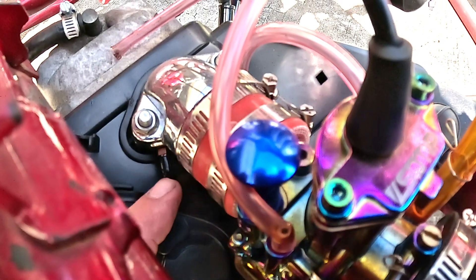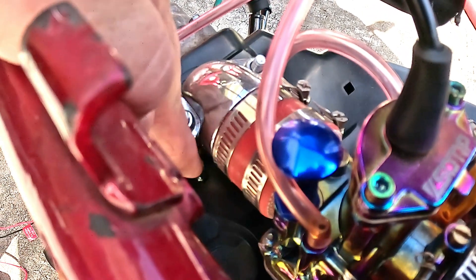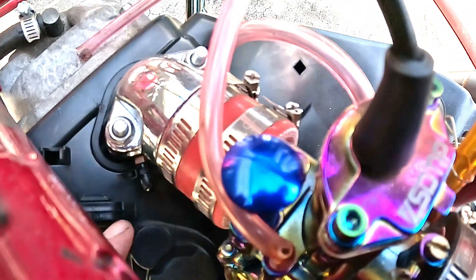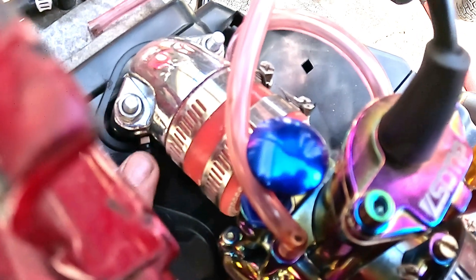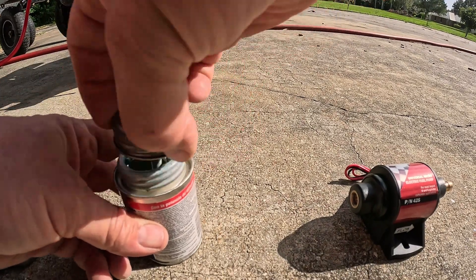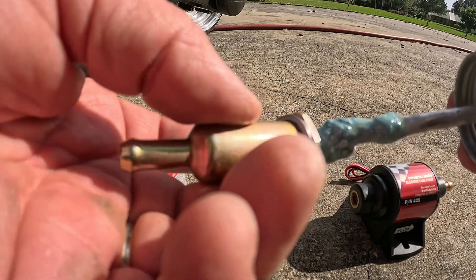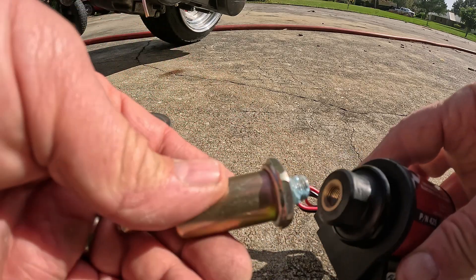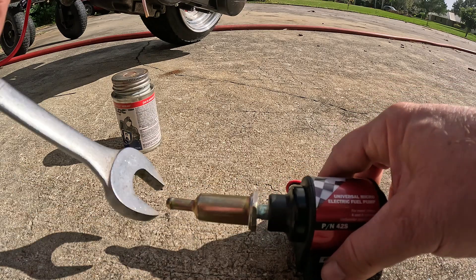I went with the vacuum port cap-off cap. Even though it's a good fit, I'm still going to put a little zip tie on there and tighten it down like crazy — I don't want any air leaks. Pulling it tight with pliers. That is actually one of the number one causes of vacuum pumps not working right — this line is too loose. You shouldn't be able to spin it freely by hand. National Pipe Taper type threads are not supposed to leak, but I found they do. So I put some kind of sealer on here; you can use Teflon tape. The main reason it leaks is because I can't tighten it as tight as I probably should since I don't trust the plastic, but you will need a big one-inch wrench or some channel locks.